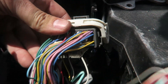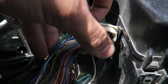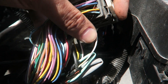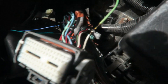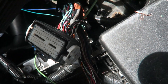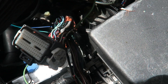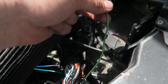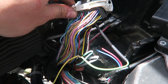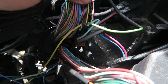Next is the yellow wire from the WAP box harness. On the left side of the ECU, go to the third row from the top and count six over from the right — that gives you a small white wire. Be very careful here. To make the install easier, I extended this white wire with a small piece of green wire since the work area is tight and there isn't much slack. Now we have our extension with shrink wrap — that was pretty stressful.